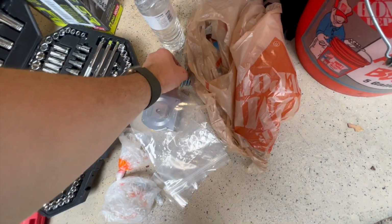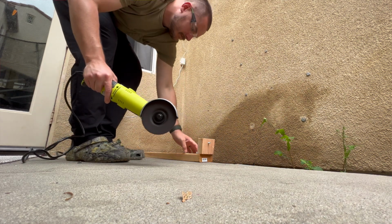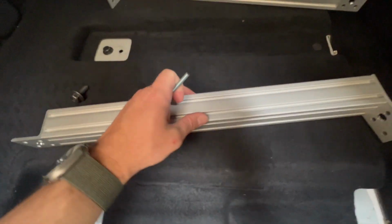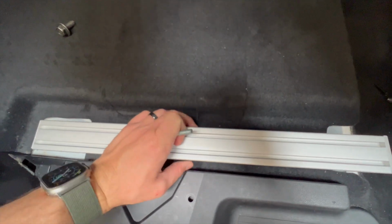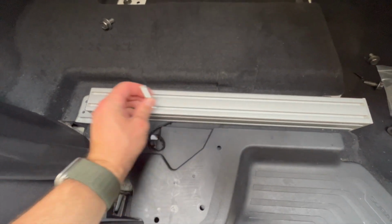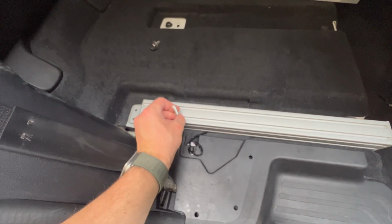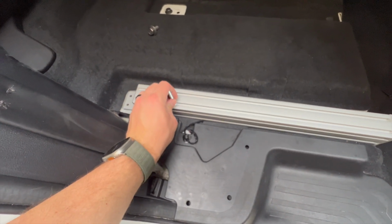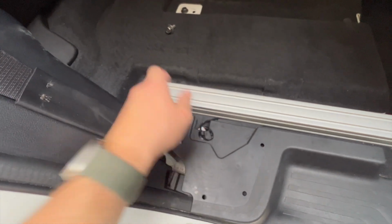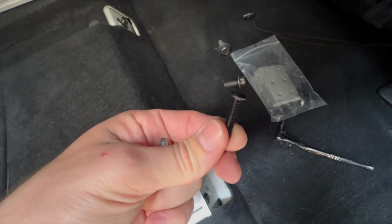And then something I did, I ended up grinding off the end of these carriage bolts, and I'm gonna use these essentially as locator bolts. So when this is in the track and the T-nuts are in the slot, I'm just gonna thread these in, and that's gonna help me align the T-nut to the floor birch panel. And then once it's aligned, I just unscrew this and the T-nut's in place underneath the birch, and I can put in the actual fastener through the birch.